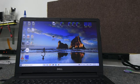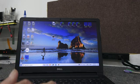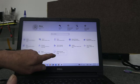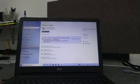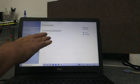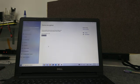Before any cloning, a couple of things I recommend: number one, turn off power management — you don't want your computer going into sleep mode while you're in the middle of cloning. Make sure you don't have any outstanding Windows updates in the queue; you don't want it rebooting on you. Also, with these Dells, go into your settings, go down to Update and Security, scroll down to device encryption — you've got to make sure this is turned off. It won't clone if that is turned on.